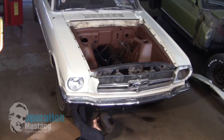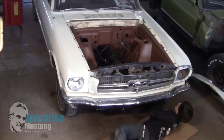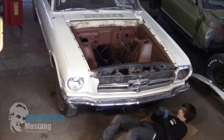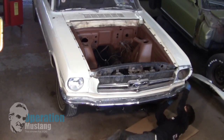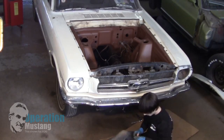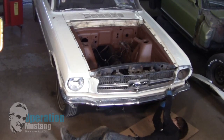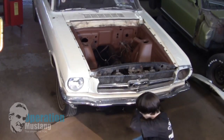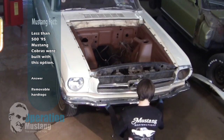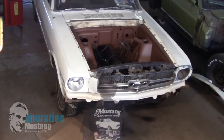There are two bolts just behind the headlamp assembly that you'll take off — do that on both sides. From there, there are only about 15 bolts that hold on the fender of a Mustang. You've also got to take the front bumper off — there are a couple of end brackets that surround the fenders on the front bumper, and then four bolts that run down the middle. It's really a simple thing. Just carefully remove the bumper and slide it out so you don't scratch your fenders.